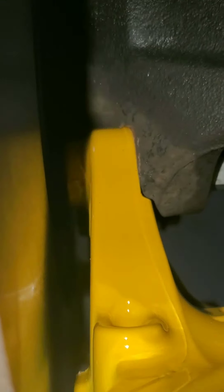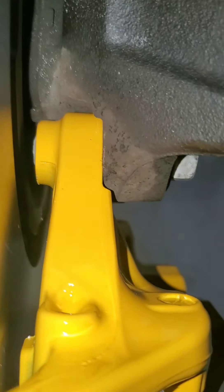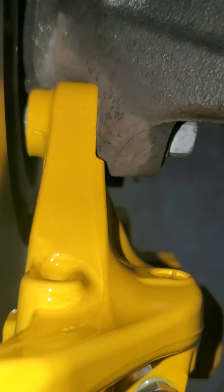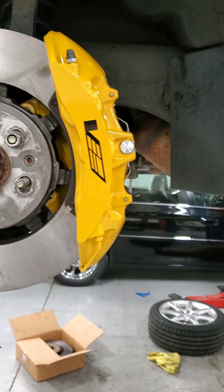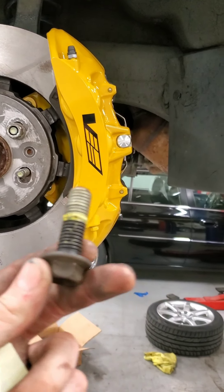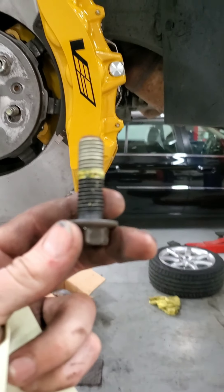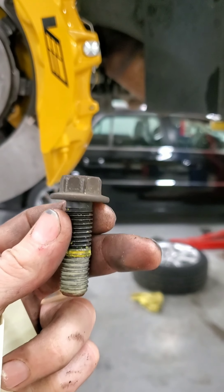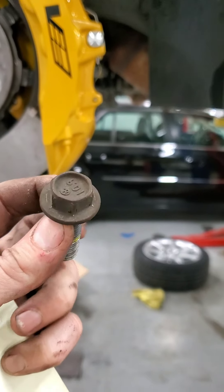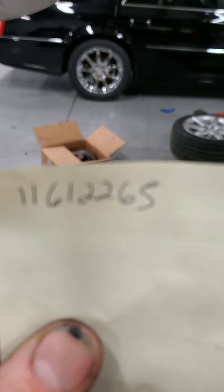Cutting off four threads worked — the rotor can now spin freely. Also, while doing a brake job on an Escalade, I found out that Escalade mounting bolts are already the correct size. This one is off a 2016 but I think they're all the same back to around 2014 or so — I can double check. The part number is right here, and with these you do not have to cut.